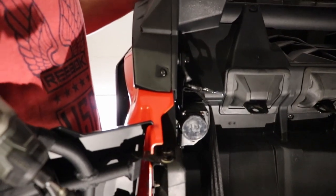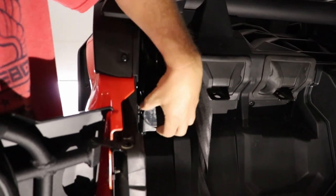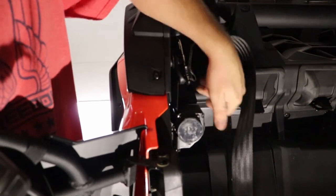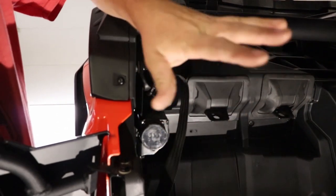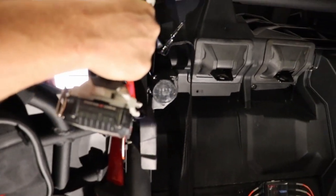All right guys, so we're going to go ahead and get the seat belt out of the way, the existing seat belt. As you can see, this is where it extracts into, is this little roller box. So we've got to take off this little cover to get to the bolt here, and the bolt right down here to take those out. That way when we do strap our four-point harnesses that will connect right to here, this will be out of the way. So T30 bit is what you're using for these bolts.